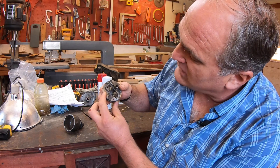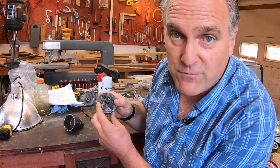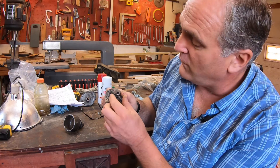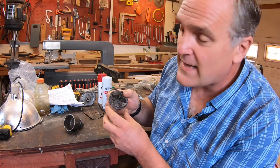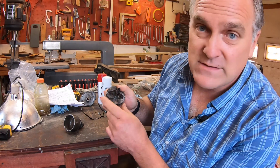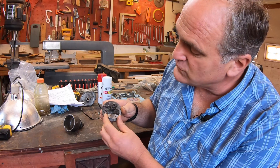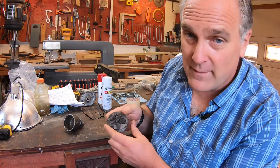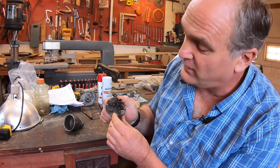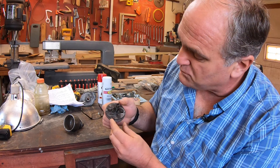So you're changing the time at which the points fire. On an H, the advance is about 40 degrees off of regular — it doesn't look like 40 degrees here, but when you work back through the engine drive chain, that's how much the timing is advanced on the crankshaft pulley. It's a real simple mechanism. This is looser than I would like, and the springs are okay. Like I said, this isn't a Porsche — it's an H from 1940. I think it'll run fine. I do have a source to get new springs for this, and that'll tighten it up quite a bit.